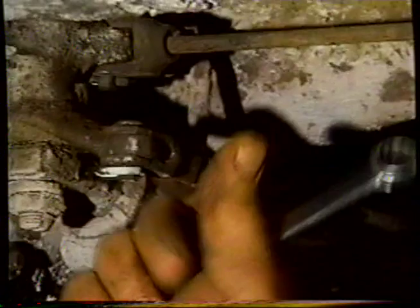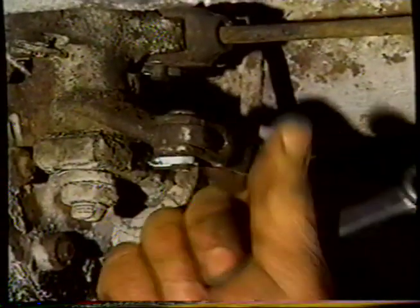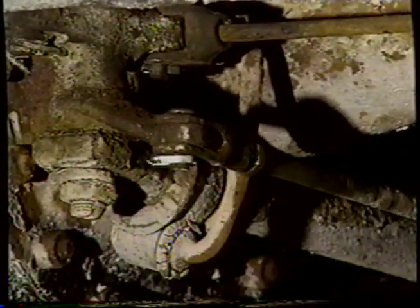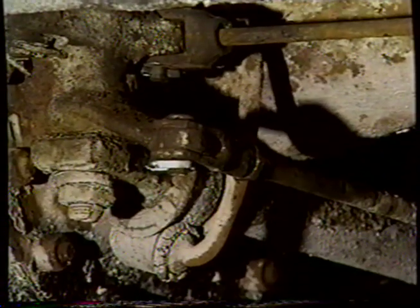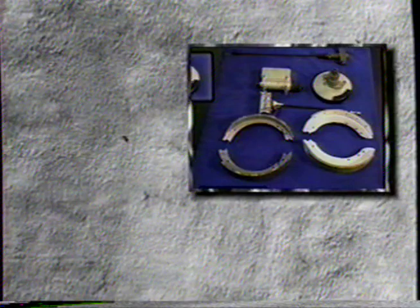And we lock up our lock nut. You can see how much free play we got rid of at the drum. That'll improve our pedal travel. And that's the compensator rod adjusted.